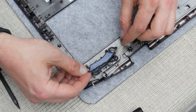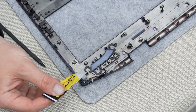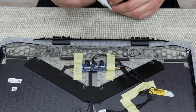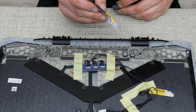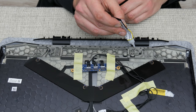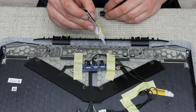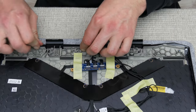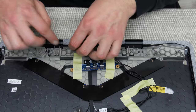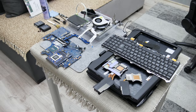In this case, I apply a plastic primer. Then, I painted the case. Then, I waited about 8 hours, until the paint gets fully dry. Then, I made some corrections, and I painted the case again. So, waiting again 8 hours. And after that, I paint the final layer. And again waiting until all gets dry. So, it took some time, but the final result, it's great. And finally, all the parts are ready for assembling.